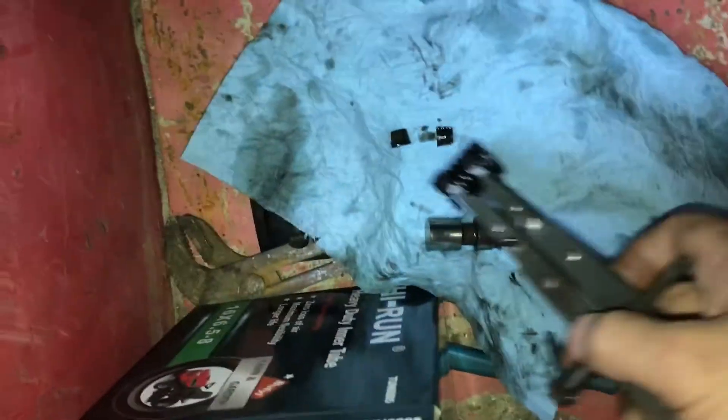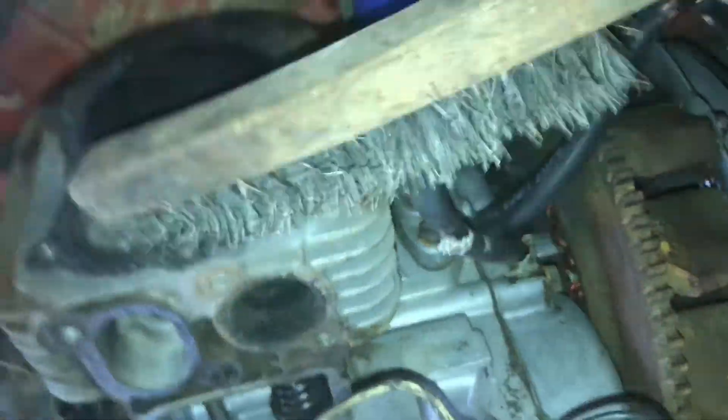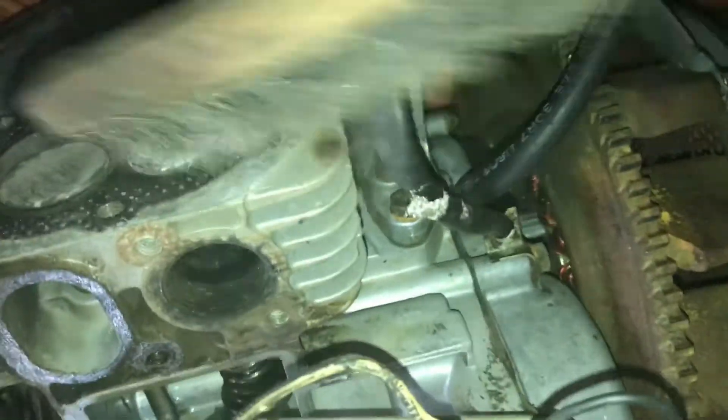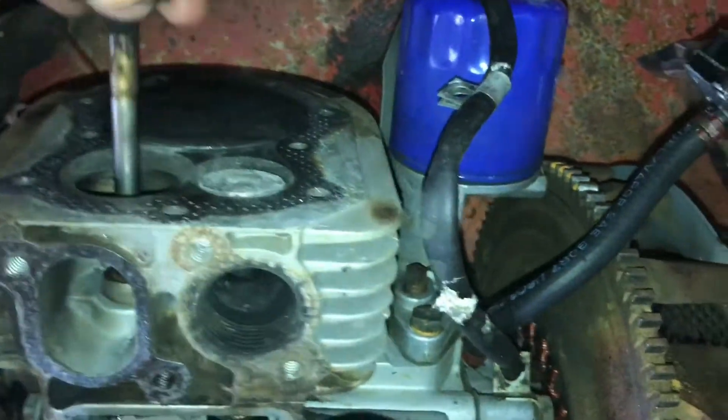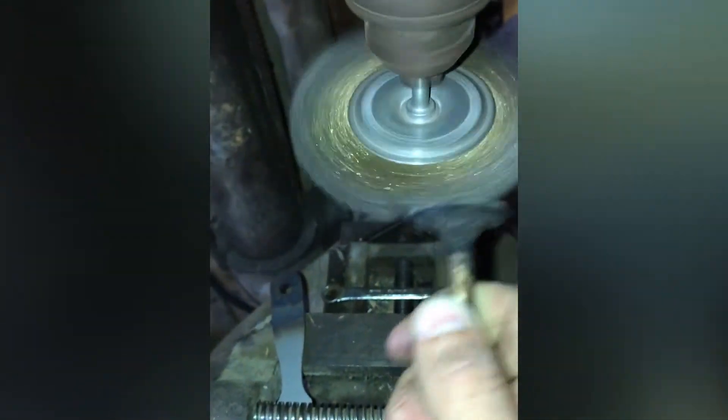There's the spring — make note of the spring up there, it's very tight. It's also a good idea to just brush off all the carbon around it, and then in a minute I'll clean the valve off. I'll tell you about the easiest way to do that. What we have here is a drill press with a normal old wire wheel — hard to do with one hand.